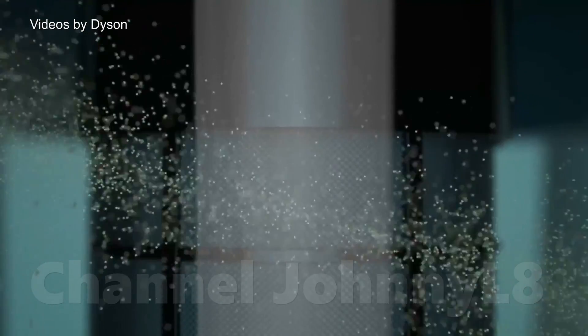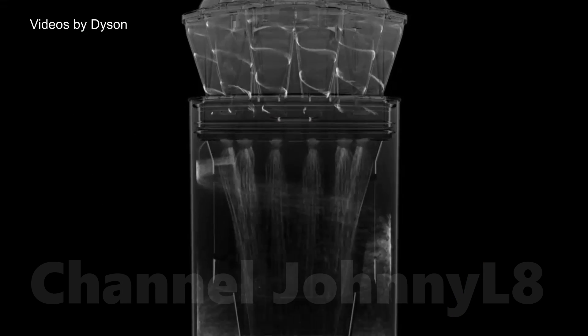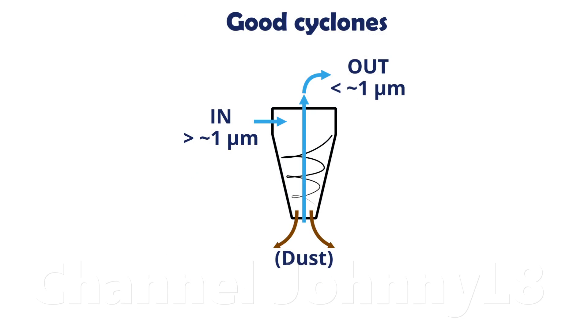The air containing these small dust particles passes through the shroud and then enters a second stage of cyclones. These are smaller and spin the air even faster. This increases the effective weight of even these tiny dust particles and crushes them outwards to the sides of the cyclone walls. They're dragged downwards in the flow and are flung out of the hole at the bottom. The rest of the now much cleaner air escapes up the centre of the cones and onto the pre-motor filter. The air by this stage, at least in good cyclonic technology that works well, has had most particles larger than about a micron filtered out, leaving only the most ultrafine dust and bacteria.